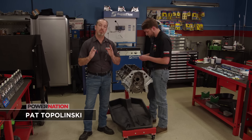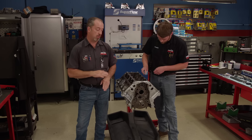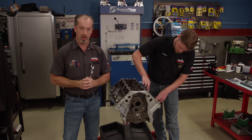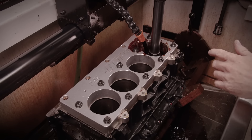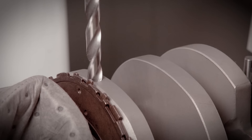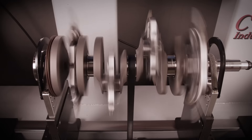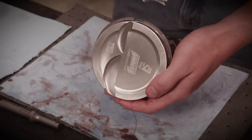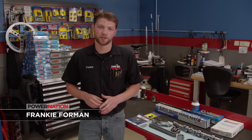Hey everyone, welcome to Engine Power. Today is going to be a great day because we are continuing on the build-up of our 410 cubic inch LQ-9 LS build. It may look a little bit different from last time — we got a little bit of paint on it. The plan for today is to get this thing all finished up, bolted together, and get it on our SuperFlow Power Mark dyno making some horsepower. We started with a clean remanufactured block, honed the bores to a final size of 4.0427 inches, balanced the Summit Pro-LS rotating assembly to better than 8 ounce-inch on the right and left side — which drastically reduces the force on the center of the crank. The piston rings were filed to 23 thousandths on the top and the second rings gapped to 25 thousandths. The crankshaft, rods, and pistons are fully forged and ready to handle the horsepower we plan to make.